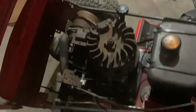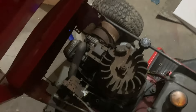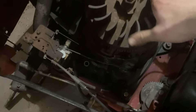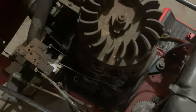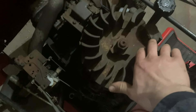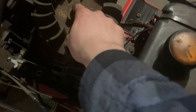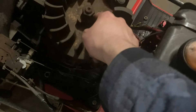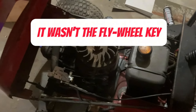It's been a little while since I've worked on this thing. I just decided to start working on it again and see if I can get this motor running. I think it's got bad timing in the flywheel, so I took the shroud cover off. There was a mouse nest in it, which isn't too terribly surprising for a tractor that's been sitting. So I'm going to start by taking the bolt off and see if it's out of time — I bet it is.